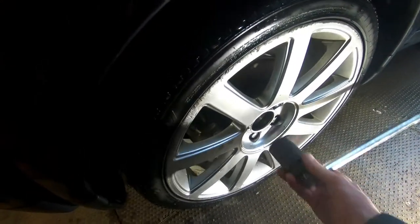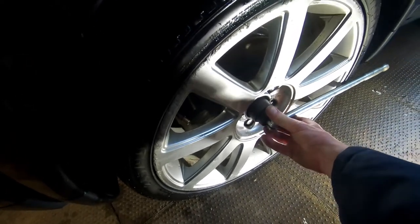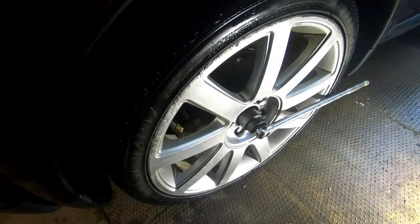To get the hub off, just keep it on the ground and use a 36mm socket to slacken the nut. Because I only had an iPhone at the time I couldn't really film how I took the CV joint and hub off — it also turned out to be quite a difficult job because the CV joint was really stuck inside the hub. There are other videos on YouTube that show you taking a hub off in more detail, but I'm just going to show you step by step how I managed to get mine off.